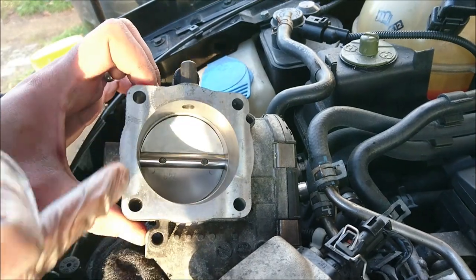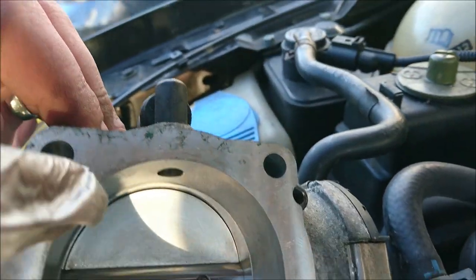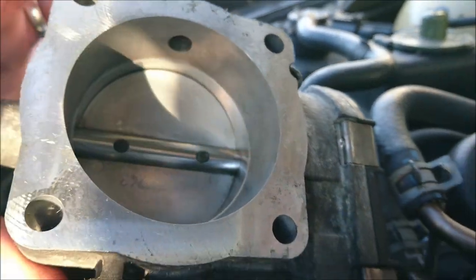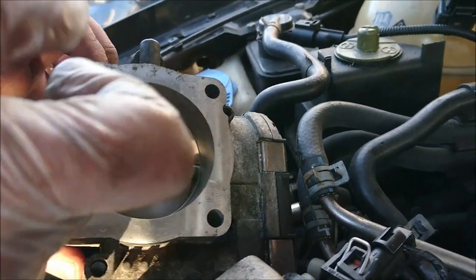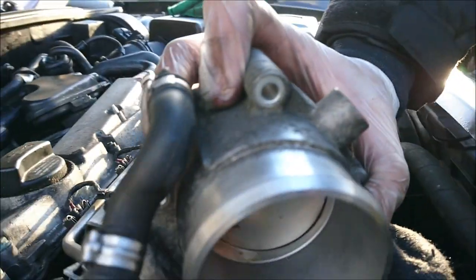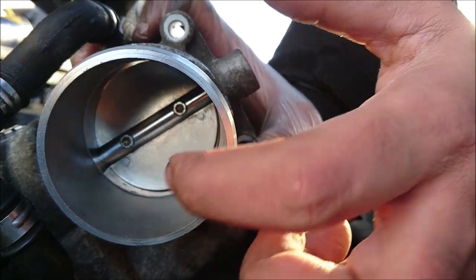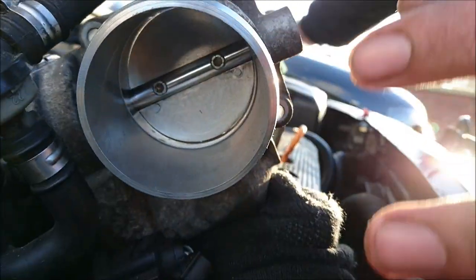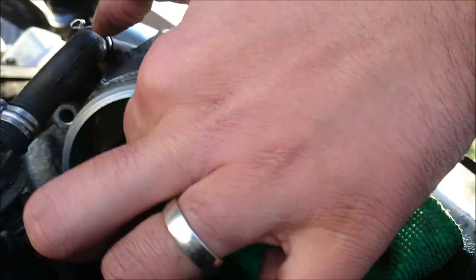As you can see it's all clean now. You can actually see the gaps at the top and the bottom of the valve which were before caked up with carbon deposits. When I put my foot in the throttle this opened up — we've now cleaned all around that as well. Both sides are shiny clean like new — that's perfect, that's how we want it to be. Before, those gaps and the valve were completely covered. Now just make sure that there's no carb cleaner left in there — dry everything up with a cloth — and then we're good to reassemble.